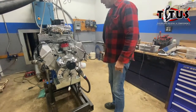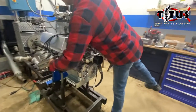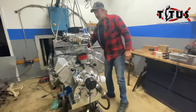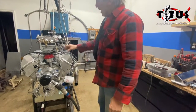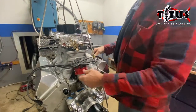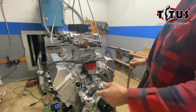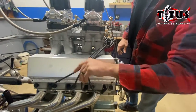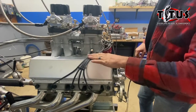We've made a little bit of progress on the engine. As you can see, we've got the headers on — I've still got to hook up the exhaust. We've got our O2 sensor on this side so we'll be able to measure O2, and we can switch that from side to side. I have made the spark plug wires. I like to order mine without the ends — I don't like universal-fit wires because I like them to fit nice and tidy, where they can't touch anything, can't burn on the pipes, and aren't hanging down or in the way.